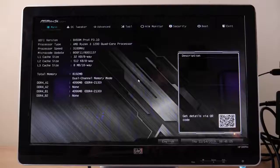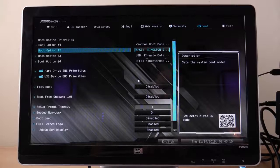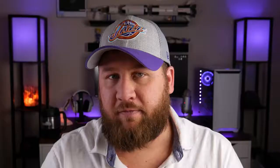If you are using an older board and you're not sure if it has a boot menu, you can go into the BIOS — typically by hitting F2 or the Delete key after you first turn it on — and then navigate to a section that says Boot, Hard Drives, or Priorities, and find where you need to move the USB drive up in priority so you can boot from it first. It's a good idea to have your manual on hand as it may tell you which key opens the boot menu or how to get into BIOS.